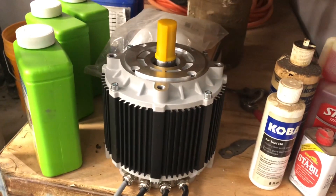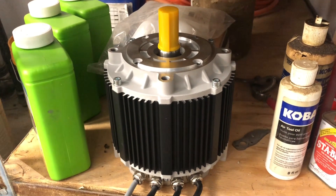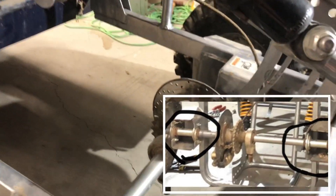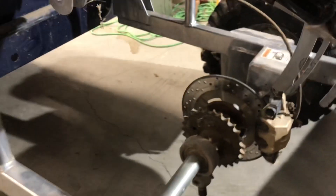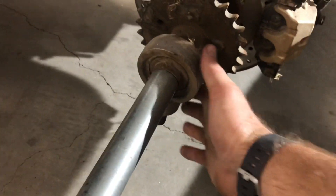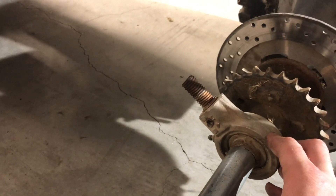Let me show you the components. This is the motor - the ME1718, rated up to 300 amps for two minutes with a continuous rating of 100 amps. It has a super linear and predictable power band. One struggle today was the axle - it attaches in a weird way with brackets that have almost no tolerance for error. I also need to figure out how to remove a tightening joint that was attached to the differential, right next to the sprocket that's going to be replaced.